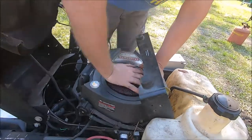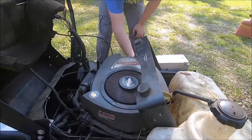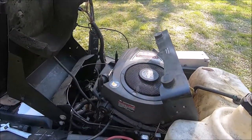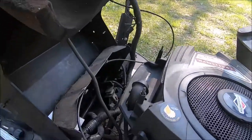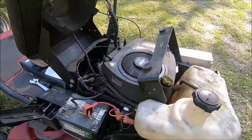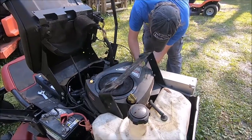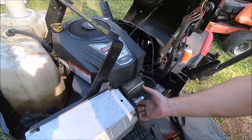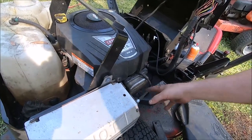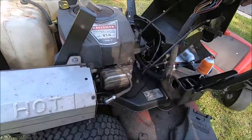Okay. There's a spark plug on this puppy, buried down there. Another way to do this is we're just gonna put a spark tester on here real quick, just so I don't waste battery power trying to crank it over if it's not actually getting spark. It's still in line with the plug, so it will still fire if it does actually manage to make a revolution here, but let's try it again.